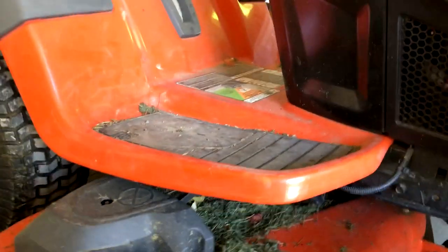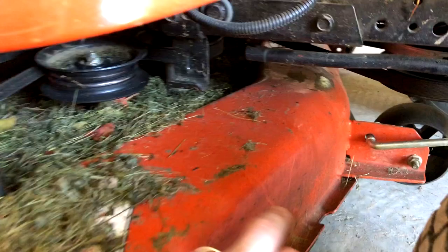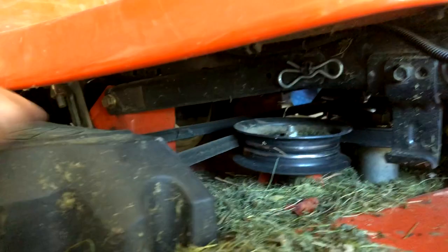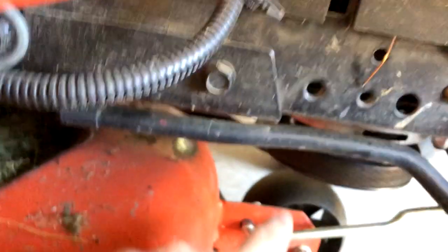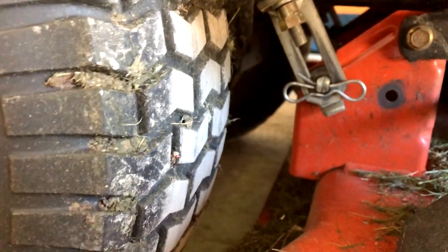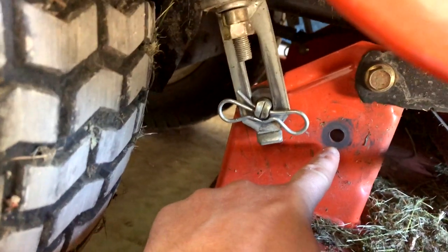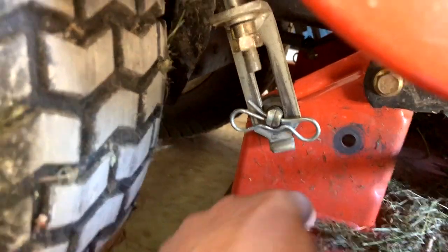This is relatively simple to do. We're going to take this deck off. The deck comes off with these pins — there's a pin here, a pin back here, and a pin up front, and the same thing on the other side. Some mowers will have a bar in the back and center as well which hooks on right here. I took mine off and never put it back on, but if you do you need to pop the pin off of that one as well.